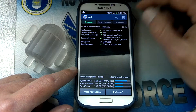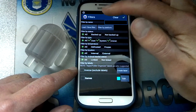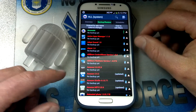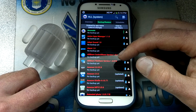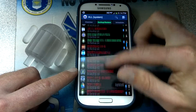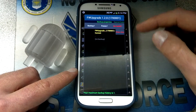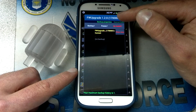What you do is hit Backup and Restore, then go to Edit Filter. Uncheck user and uninstall so you can see what's on your system. Now there are two APKs. The first one is called fwupgrade.apk — you can probably just type it in to make things quicker. Find fwupgrade 1.2.0 — you have the option to freeze right there. Go ahead and hit Freeze and you freeze this upgrade from happening.